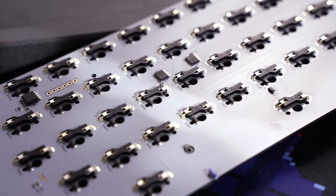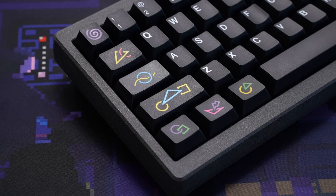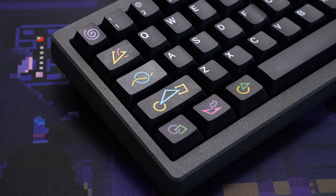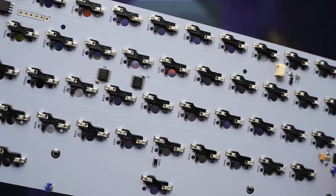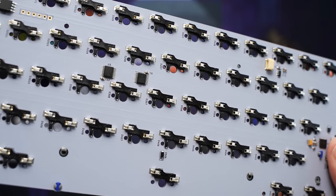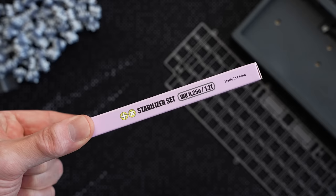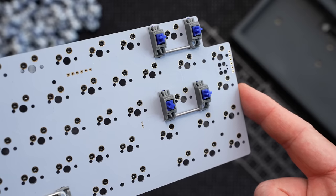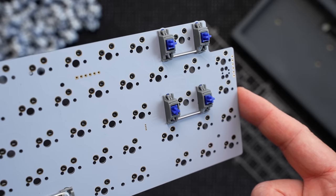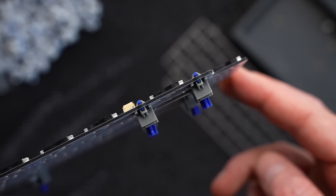The PCB is hot-swap by default and only supports a 6.25U spacebar. You do have the option of stepped or regular caps, but aside from that you're locked into the layout. They do have an additional solder kit if you want more options. The PCB doesn't have flex cuts, which makes for a fuller sound, but it is thin at 1.2 millimeters versus the standard 1.6. They don't include any shims, so I went with TX 1.2 V3 stabilizers. I've used pretty much every stabilizer out there — TXs are always my go-to. They're snap-ins, easy to tune, and really consistent.